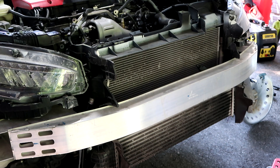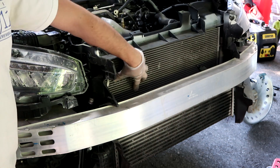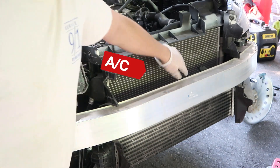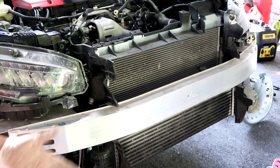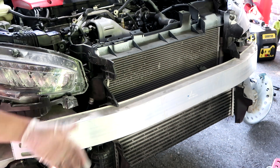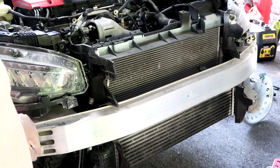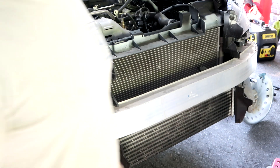Here we go pulling the radiator. A couple of things I'm going to do — I'm going to take the condenser off. This is right up front. A lot of you guys have said why don't I remove this, it'll increase cooling capacity. For what I'm doing — time attack — I can do one or two hot laps, a couple of cool down laps, another couple hot laps. That's basically my aim, so I'm not too worried about that. Let's go ahead and remove that — I believe it's 10 millimeters.